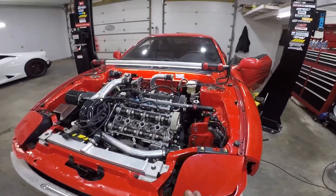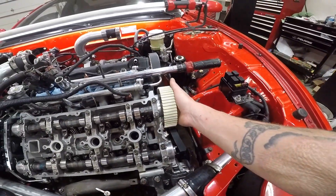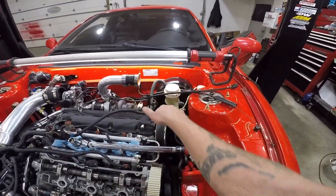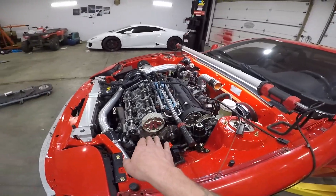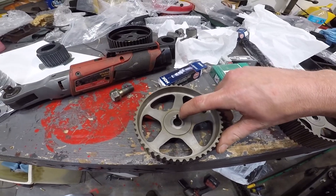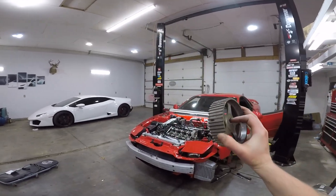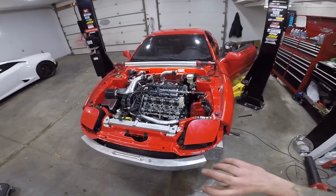I need a third arm. If I can force these cam gears toward the back as I tighten them, I should get them in time perfectly — because the back ones are already perfect. That makes sense because gravity is pulling those ones that way. So if just the right side of these cam gears is shaved a little bigger than it's supposed to be, gravity on the front would make them hang off, but on the back it falls into place perfectly. My buddy's here — I can hear him dumping gravel. He doesn't like to be on camera. I'll bring you right back.